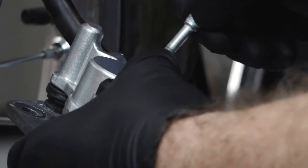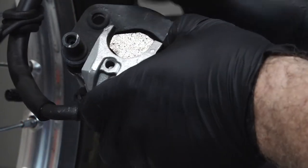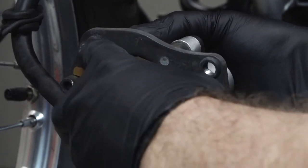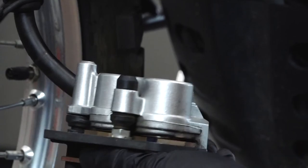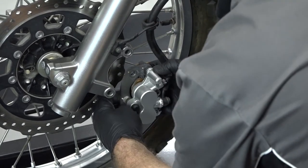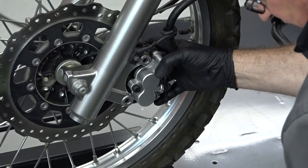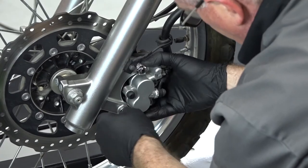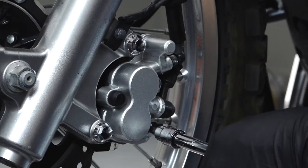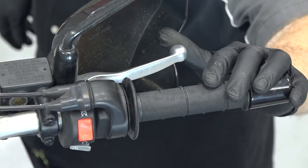Alright, go ahead and put those in — the inside set. Push them down on that spring. Get your pin just started. Same thing for the other side. Now get your outside in, push down all the way through. Get these hand tight and we can get it remounted. There's plenty of room there. Get our 12mm bolts back in and get those snugged back down. Do not forget to tighten down those two pins. And with that, go ahead and pump up your front brakes.